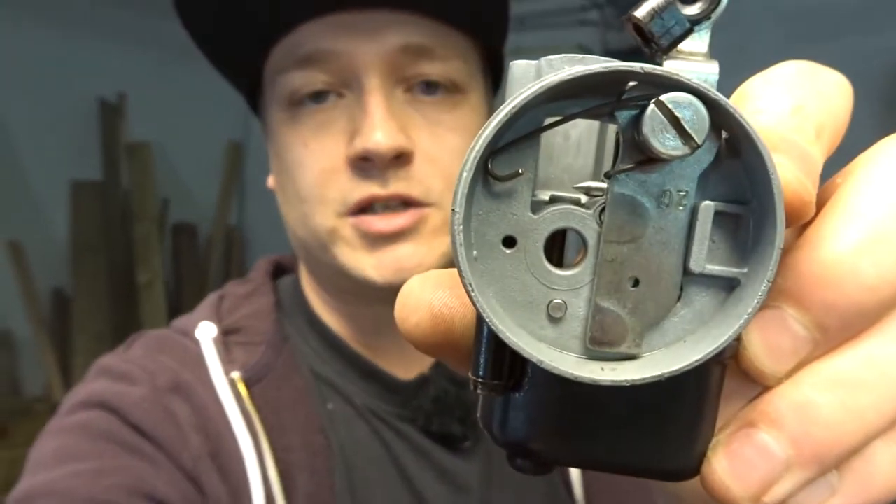I checked the old carburetor and as you can see it has a bigger hole. When we compare it to the smaller carb, yeah, that is a small little hole. I don't want to keep the 13mm carburetor on here because that is for the Ciao with the 65cc. At home I still have a 12mm carburetor that I have to clean and then I can put it on. That is what I'm gonna do another day, but for now it works.